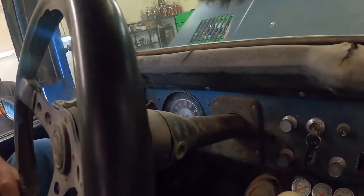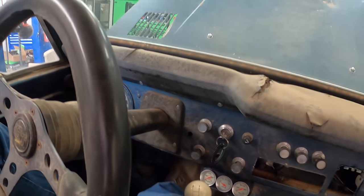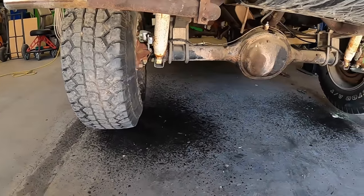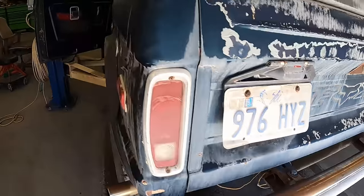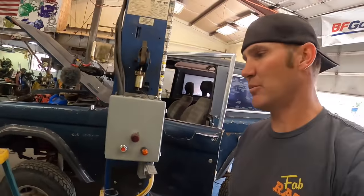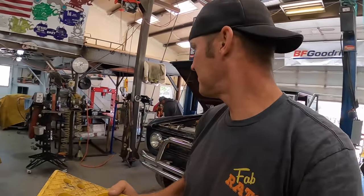All right, we're in the Bronco, trying to get brakes. It's like a solid six pumper probably — that'll be all right. My job is to pump it up and he'll bleed the air out. Pretty easy process. As you can see — brake fluid. It's on the floor, it's all bled up, we've got good pedal. We'll throw some sawdust on it — I think we're good to go. We're about ready for a test drive.